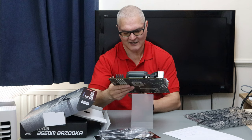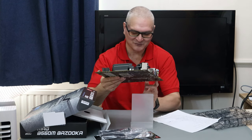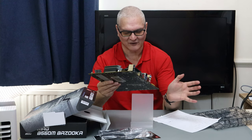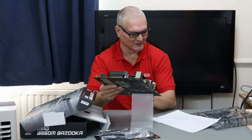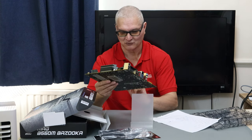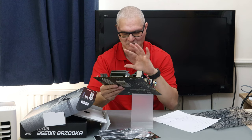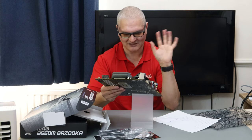There's a TPM header — the Trusted Platform Module — which is needed for Windows 11. The B560 chipset also supports Intel PTT (Platform Trusted Technology), which does the same thing, though the physical module does a better job. Unless you're really security-conscious, the Intel PTT works perfectly fine with Windows 11. I've tested it with a 33–34 game test run on the last motherboard to confirm it works.